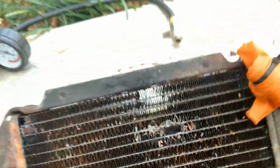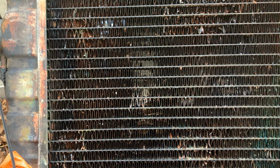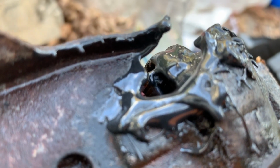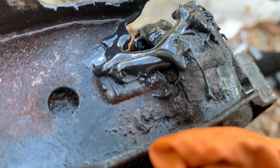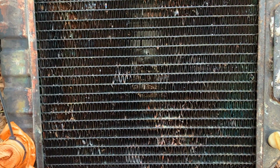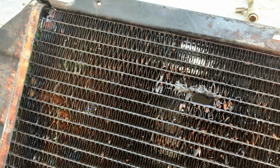So yeah, it's not pretty, but this radiator is just a mess. One thing to know, this radiator is pretty much junk. I really would not want to spend the money taking it and getting it done unless they could just recore it completely. I don't know what that would cost, but it's rusted out. The supports are rusted out. You can see right in there. I threw some JB Weld in there, just some extra to build that up a little bit, with what I had left over after mixing some up, to help bridge that back up and give it a little more strength back. It was starting to set, so it didn't look the prettiest. So we're just trying to get it to seal. Unfortunately, you can see that nest of whatever pack rat was built up all in this radiator. So it hasn't fared well.